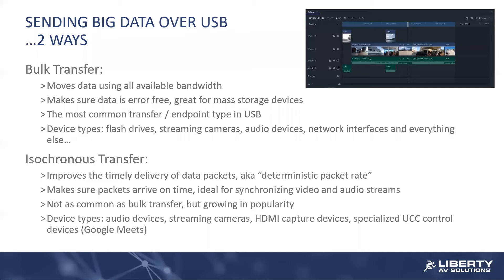That's why it's kind of up to the hub vendor, or in our case if we're doing extenders, that we support enough current out of that power port to prop up that camera. So there are ways around that — typically if you have the luxury of having a secondary USB port nearby, you can use what everybody's seen as Y cables. One's for data and power, and the other one's just to prop up the power through what's called droop sharing. So you're basically running power out of two ports at the same time to give that camera all the current it needs.